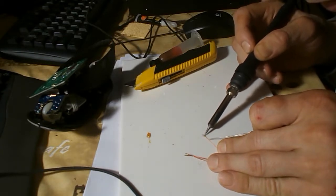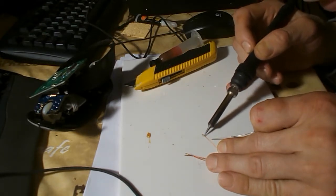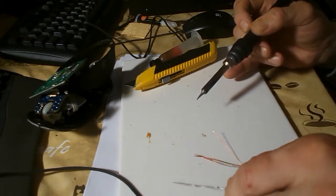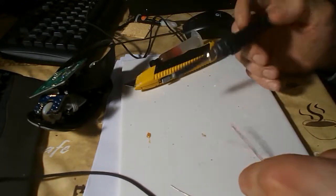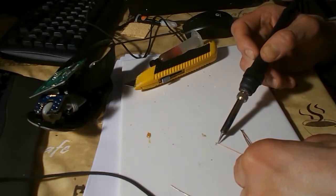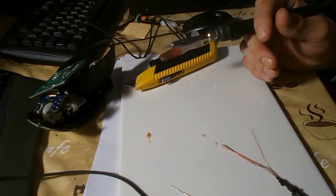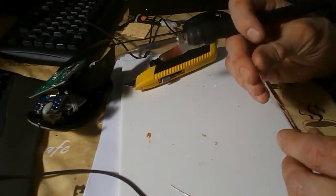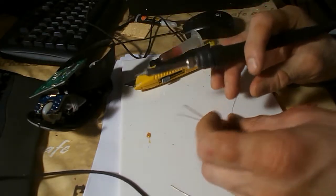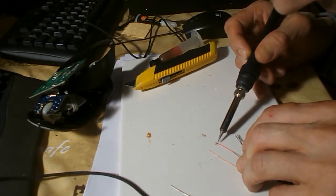The idea is that if you jiggle with it a little bit, then you will be able to melt the, how do you call it, varnish that's there that protects the wire, insulation, let's say, and the solder will stick better. I'm desperately trying to speak English today. Anyway, it's because I'm focusing on these things.